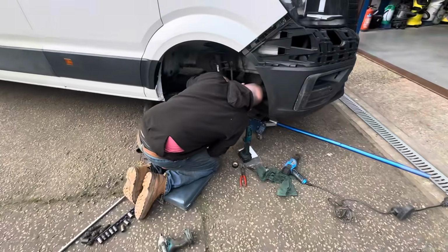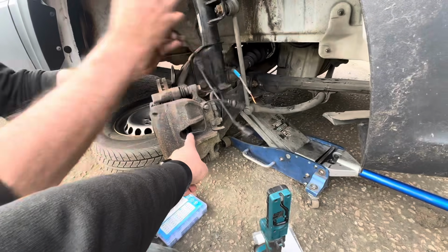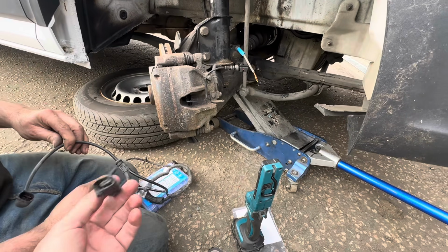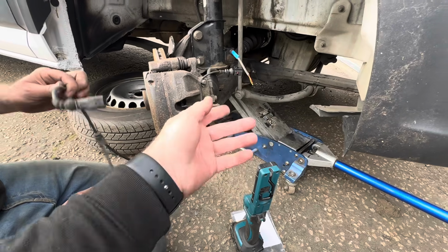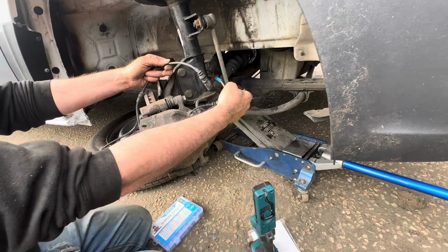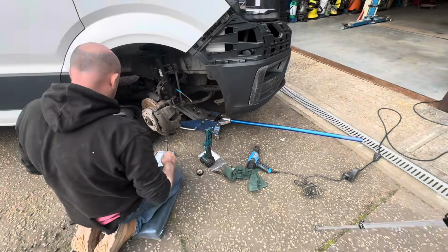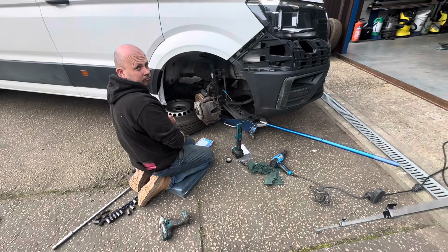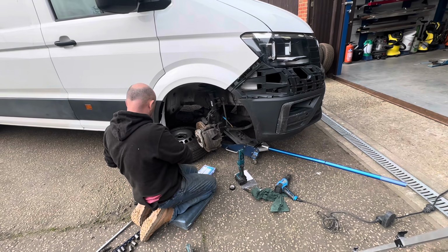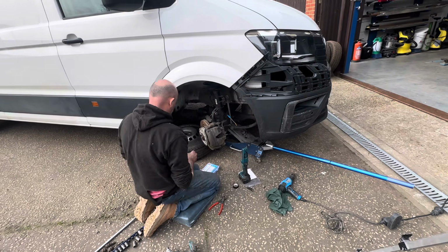And then moving on down here, he is fitting that new brake pad wear sensor I went and got, and then this loom was actually ripped off and cut, so I got this patch loom out of another one, and Chris has obviously got to put a little join in it somewhere. Yeah, it's only that piece, just that piece for the plug for the brake pad wear sensor. So we'll let him crack on with that, and once he's done that, I believe we'll be at the stage where we can actually plug this in and try and clear down some of the faults it's got, because it has got a lot of faults, and of course it's got no power steering. Right, we'll let him get on and give it a go.